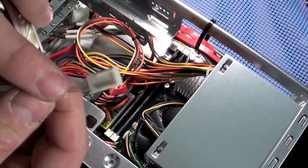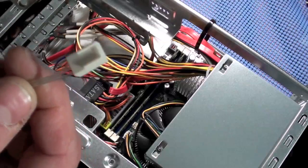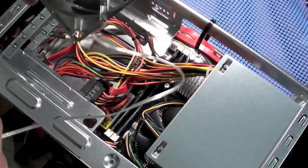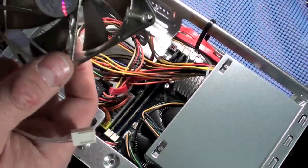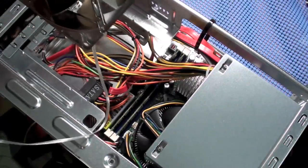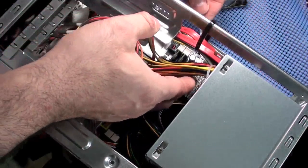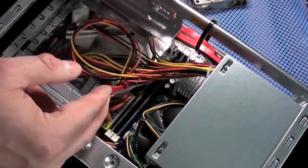And if you see 3 wires, that's going to give you an added benefit, because it's going to give the speed of the fan's information to the motherboard, so the motherboard knows what speed the fan is, and it can also ramp it up and ramp it down. It can change the speed of the fan if needed. If it starts getting too hot, it can ramp it up. If it's getting cool enough, it will slow it down, save you energy, and make it quieter. Quieter, that's a word, right?